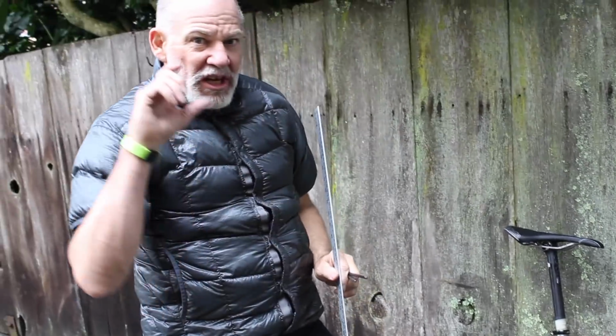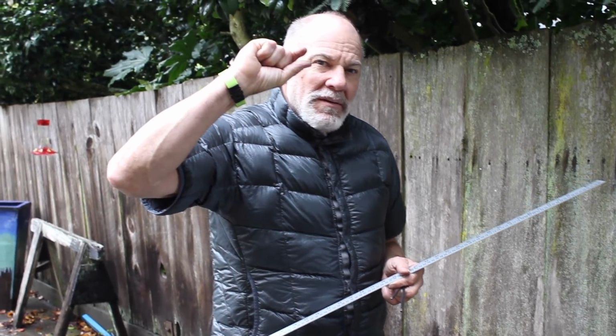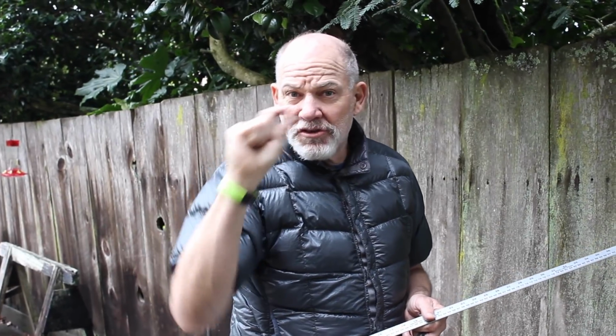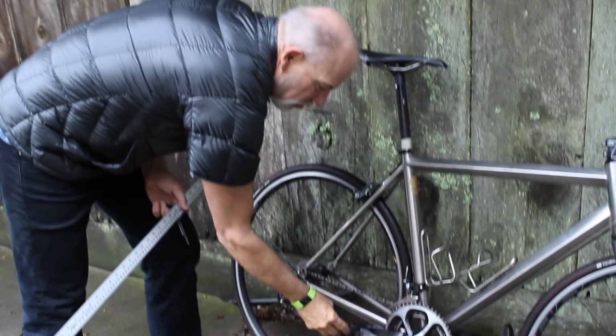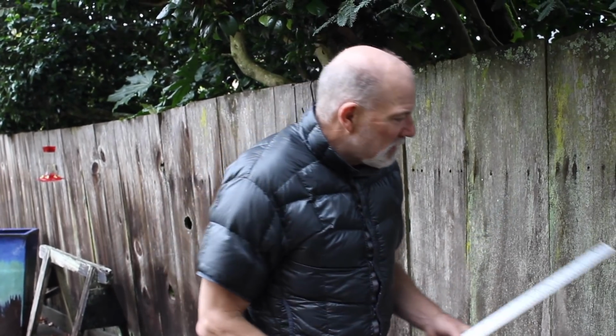When you change your cycling shoes, it is possible that the difference matters. When my saddle height is even 1.5 or 2 millimeters off, I can feel that it's different in my pedaling. But that has taken many decades to arrive at the exact sensation required for each pedal stroke. The thickness of your cycling shoes is different, and there is a wide variety. Generally speaking, the thinner the better, because you get closer to the pedal spindle when you have a really thin sole. But nowadays with carbon soles, most top-end cycling shoes are within a very few millimeters of each other. But if I have been using a pair of shoes and they're a little bit thinner or thicker than the shoes I change into, I can feel the difference in the saddle height.